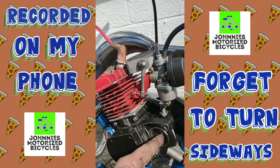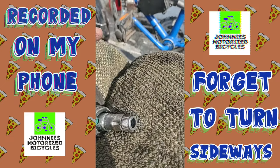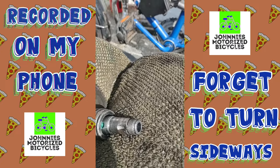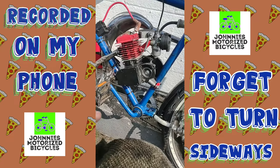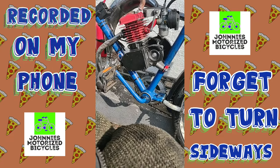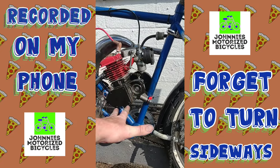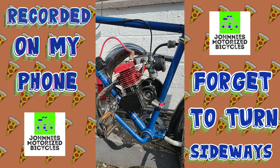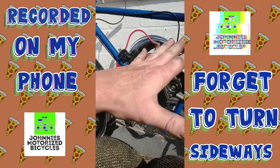On a plus note, the bearings are glassy. The shaft is the original shaft to this motor. The bearings, spring, all that is original to this motor, the Sutec. The basket was what I was having problems with, and I put a new clutch basket on from one of my YD100s, and we're having clutch issues again. The reason I took this apart in the first place was the clutch issues. The basket's good, but it seems the shaft is a problem. So I'm going to take this apart and we're going to put a new shaft in here and just be done with it.